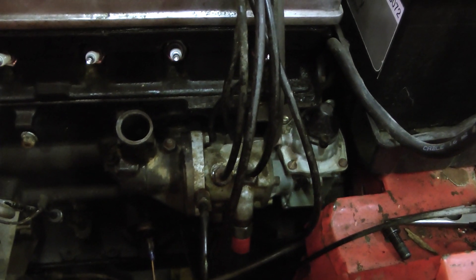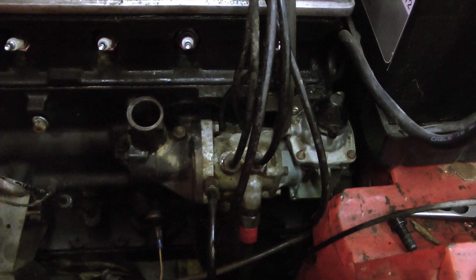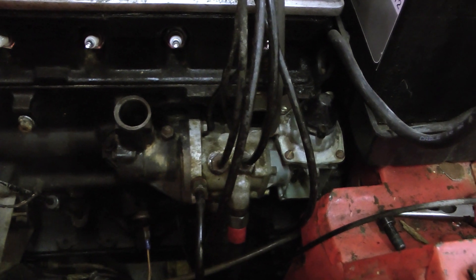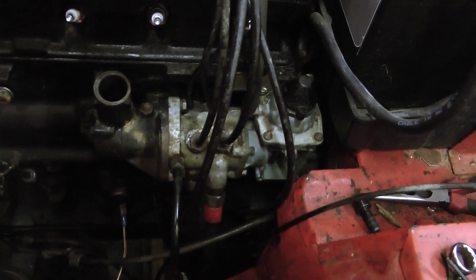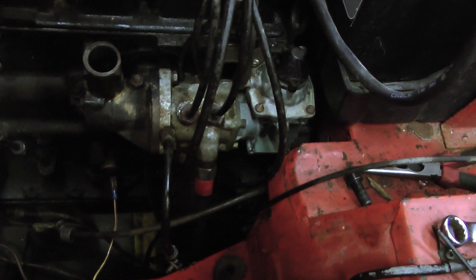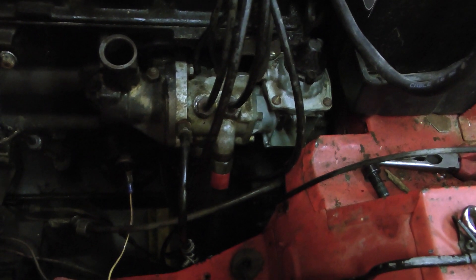It's leaking, I know. I need to look at that. I've had the unit off because the fuel tank was full of rust - the fuel filter was made of rust. Long story cut massively short: I stripped everything down, took this out, didn't take it completely apart, just took it out and made sure it was nice and clean inside - and it is actually spotless inside. Fuel pressure was deemed to be the problem, so I've made a new fuel line. We found a really badly pancaked bit of fuel line. So that's all back in and now we have enough pressure to produce a fuel leak - which is actually a good thing - because before, the fuel wasn't even coming out of the poppet valves.